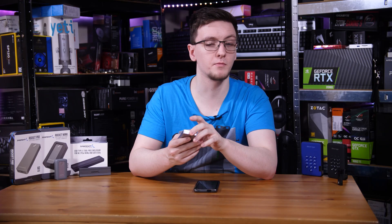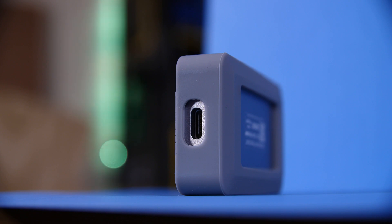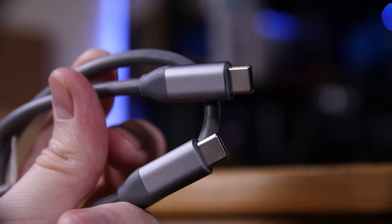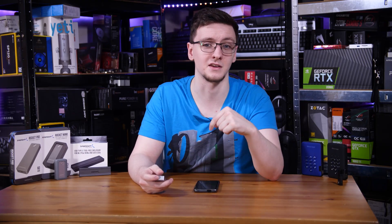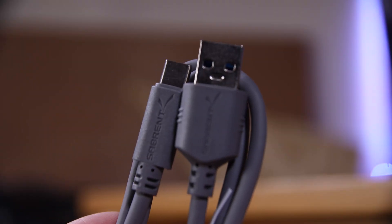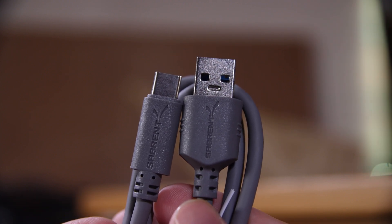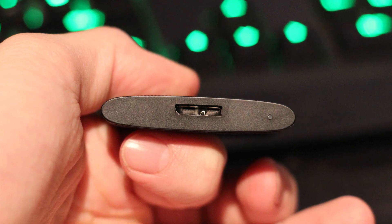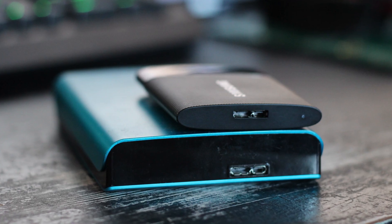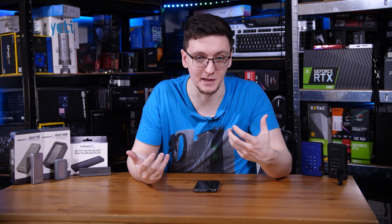But what about connectivity? The majority of the drives that you can buy today will come with USB Type-C ports built onto them and a selection of detachable cables in the box. These Sabrent drives come with both a USB Type-C to Type-C cable, which will be useful for connecting to newer computers, especially laptops and even things like your phone, and also USB Type-C to USB Type-A cables, which are useful for connecting to fairly standard desktop computers. There are also some older drives that might have the USB 3 Micro-B ports, which was honestly awful — very fragile, easily able to break, and often a bit slower, more like 5 or 10 gigabit per second than the 10 or 20 that USB Type-C can handle.